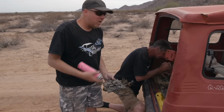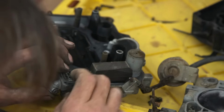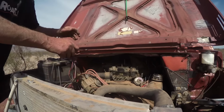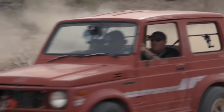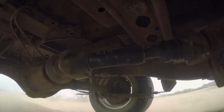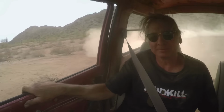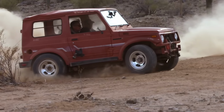We ran back to the junkyard and got the thermoquad that was on the 440 when we first got it. So we're gonna take the float out of the old thermoquad and put it in the Dulcich thermoquad. Well, I think I've got this thermoquad fixed. I'm just gonna plop it down on our 440 and the Samurai will spring into action once again. That's a lot better. The thermoquad runs great. Yeah, it does now. Whoa, that was a good one. Yeah. Pretty good brodies.